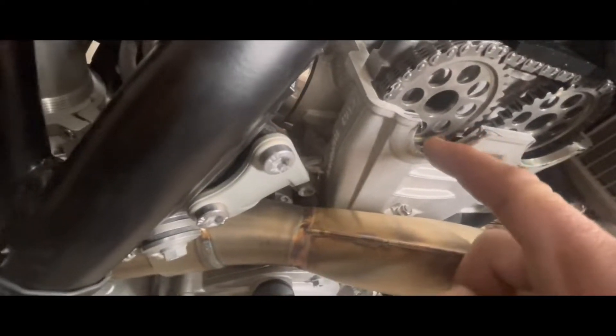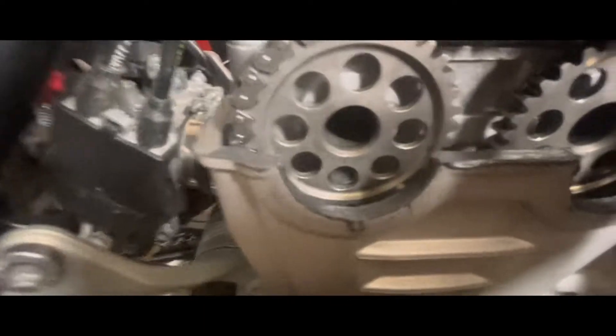Get all that gross stuff out with a rag — as you can see all that black stuff. Then we're going to get a little bit of RTV and just smear a little bit right here — that's the trick so these don't leak. Just give it a little smear. Make sure you get all that oil out of there so you get a good seal. Let it cure overnight before you fire up — it's Permatex Ultra Black, really good stuff.